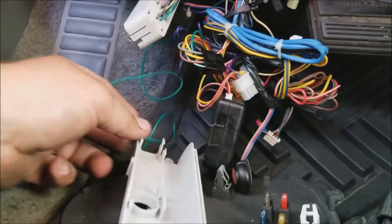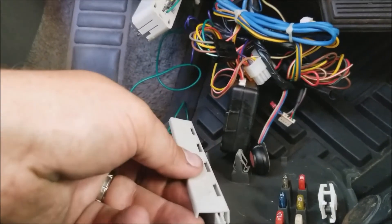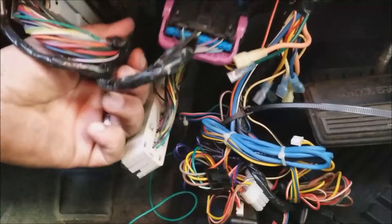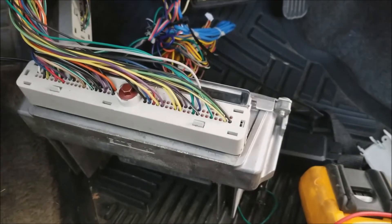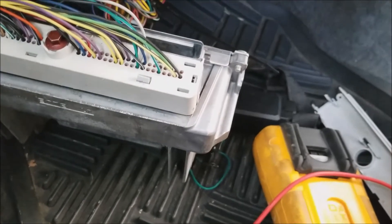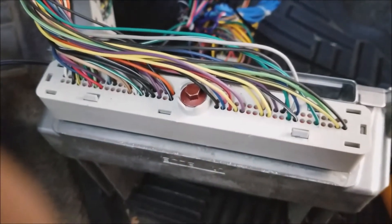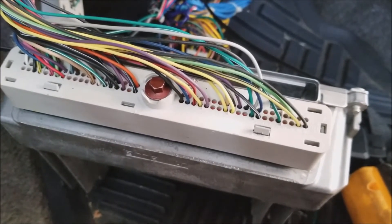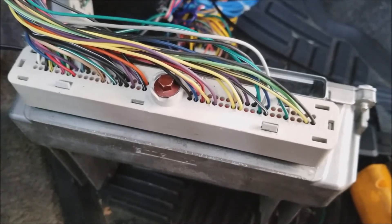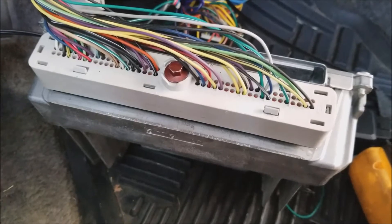This cover slides off the front so these wires will come down and out, and then these tabs hold it on — you take those out to expose everything. With the second connector out, I can get the PCM all the way into plain view. You can see pins 64 and 65 are where those wires come in from the vehicle speed sensor. We're going to see if we still get that sine wave here at the PCM. If not, it's a wiring issue; if we do get it, then the PCM is likely bad.